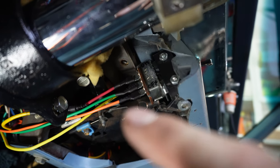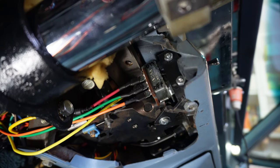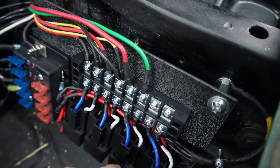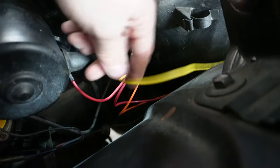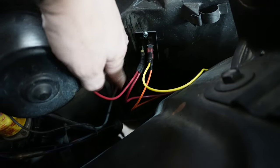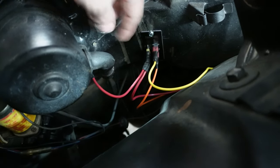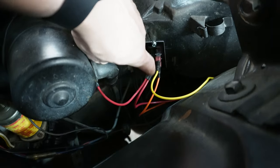Back at it again — I think I just got the blower motor completely wired up. I've got red as power, orange as low, yellow as medium, green as high, and it works. Over here, yellow and orange — which are resisted — go off to the resistor, and then green, which is high, comes over and activates this relay, which sends the full 12 volts back out the big wire to the blower motor. Orange comes in to the lower connection, yellow to the high one, and the red wire from the relay comes in here, which is also the output from the resistor. So if it goes through low or medium, it goes through the resistor — the air from the blower blows on that resistor and keeps it cool. If it's on high, it bypasses the resistor via this connection and gets a full 12 volts.